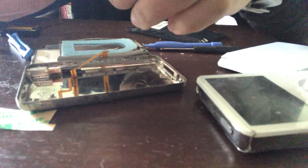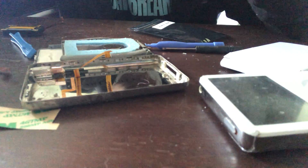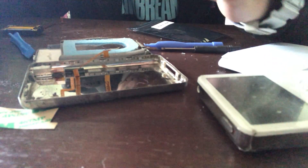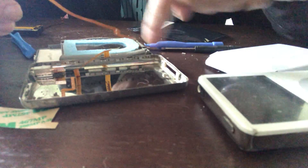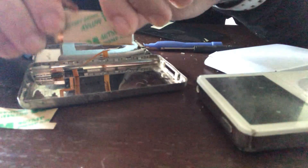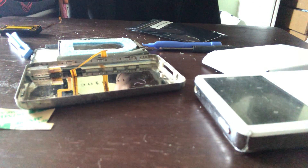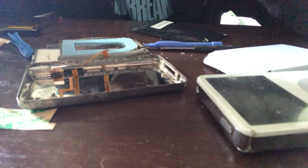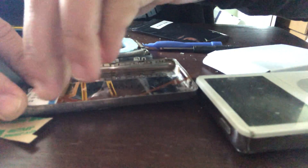Here's the new battery. We've got to make sure we do it right. It's going to look like this — sitting on there like this — and the chip tab right here is going to be facing up when we're looking at it like this. The iPod battery has a 3M adhesive backing, so we're just gonna peel that off. You can feel it — it sticks. We're just gonna stick it back on the back panel here carefully, like that, making sure it's in place.